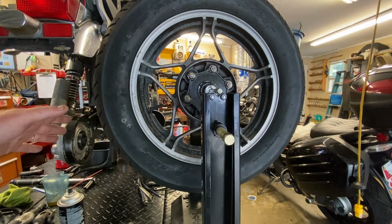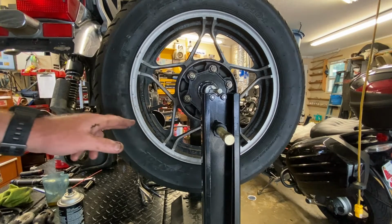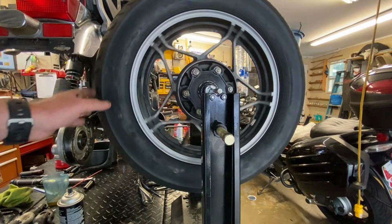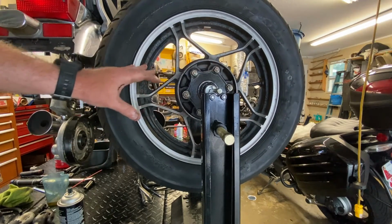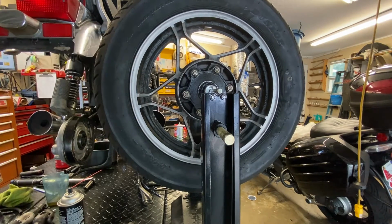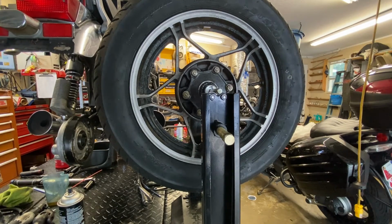And it's a lot easier to set a tire up when you know you have a spot that here's the heaviest spot of the tire, here's the heaviest spot of the rim. Now we can work around those 2 and counterbalance those imbalancing forces. So I think theoretically that's why it's done. That's the story I'm sticking to, but it works good for me. So like I said, it may not be the right way, but it's the way I do it.